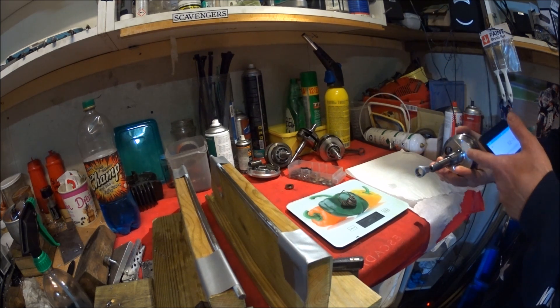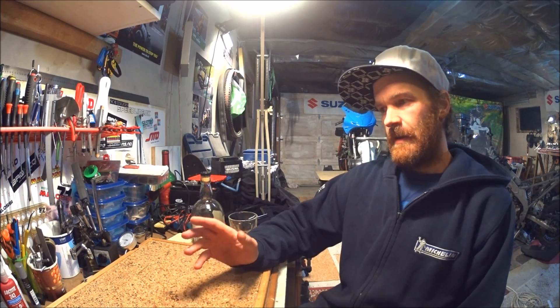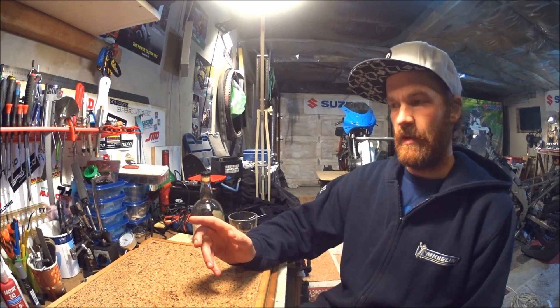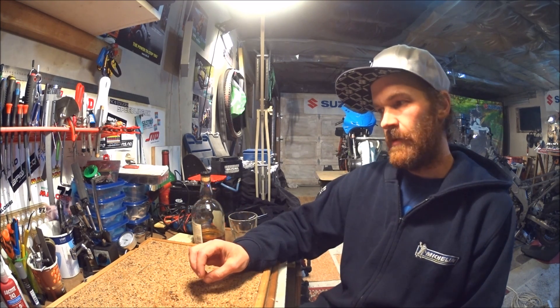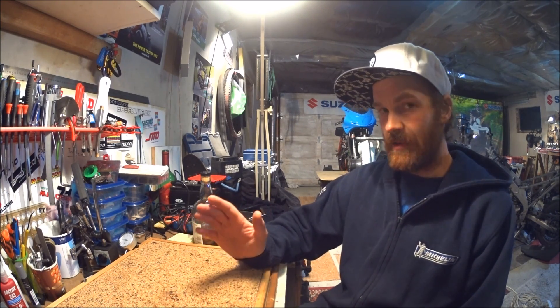Obviously I've calculated something a bit wrong, but anyway we will assemble and try with this balance factor. So that's it for this episode. We managed to rebalance the crank to a slightly lower balance factor than I originally intended. I had obviously done something wrong in my measurements, or maybe the tungsten alloy slugs weren't as dense as real tungsten, because that's what I used in my calculations. Anyway, we're close to 50% which should be okay and much better than what we had before. Stay tuned for the next episode which will be the reassembly of the engine. Please like and subscribe, and I'll see you next time.